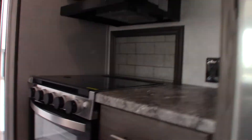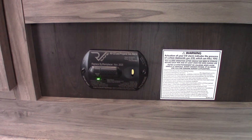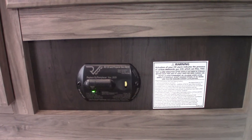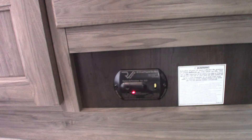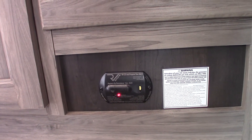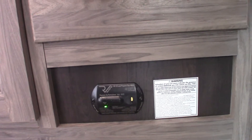This device down here is your carbon monoxide and LP gas detector — it detects both. If it goes off, take everybody outside, leave the door open, shut the gas off at the front and figure out what's going on. If it beeps very slowly, it's telling you your battery is low. Running the self-test now — LP/CO check, then low battery alert — and back to green. It should always be green; if not, get it serviced.